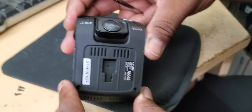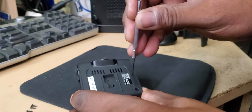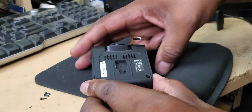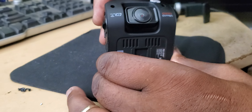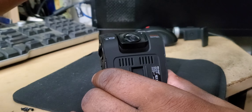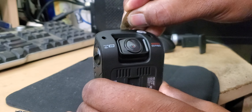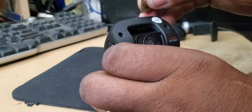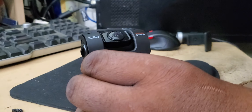On the Rexing it has four holes — one, two, three, four. I'm going to use a tiny Phillips screwdriver to take out those screws. I've already taken out the first three, so this is the last one. From there it's real easy — you just get your fingers underneath the edge, or you can use a pry tool or a flathead screwdriver. I'm going to use a guitar pick as a pry tool and get under the edge and try to pop it out. Okay, there we go — it just pops out.